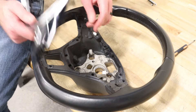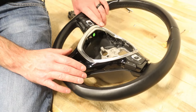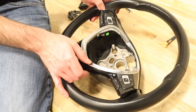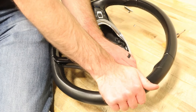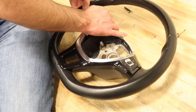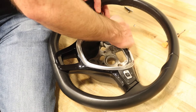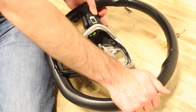When reinstalling, we're going to plug this into both of our white connectors and then pop this back down in place. We're just going to push down and kind of walk it around as we do it. Make sure those parts of the steering wheel where the leather pulled up are good and down before you do anything. There was a little bit of cracking — nothing cracked — but if you push and don't get enough even pressure you could have that. Try not to force it, just lean into it as you walk it around.